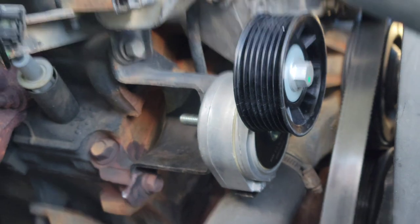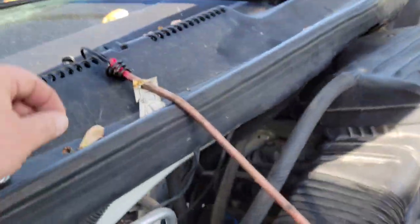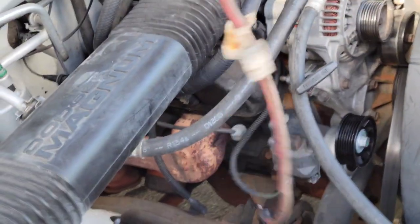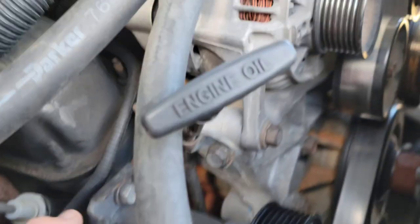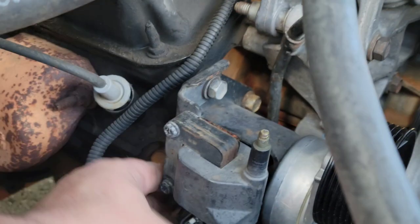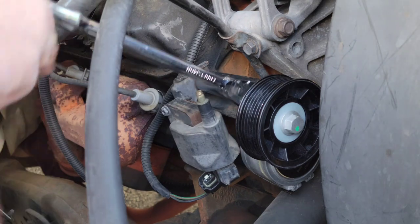Alright, now we got the belt tensioner in. We're going to go ahead and put the coil and bracket back into place. Remember, yours is a little bit different because your bracket will not be broke — mine is. So like I said, we had to rig it up. We're going to go ahead and let this loose, let our coil and bracket fall down into place, throw this little gadget off to the side, grab our socket and wrench, and tighten this top bolt up. We've got to keep that coil and bracket lined up perfectly where they sheared off, and hopefully when we tighten the top one, that it will keep it in place.